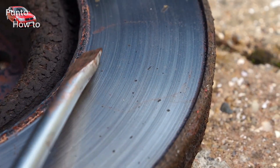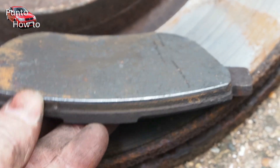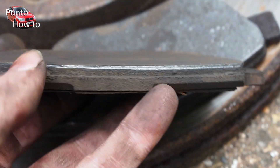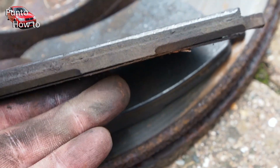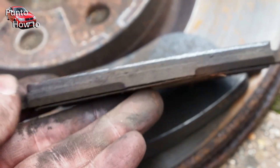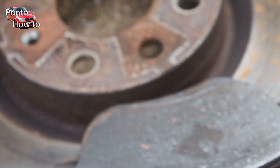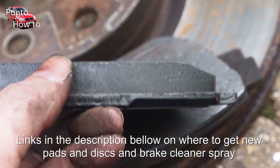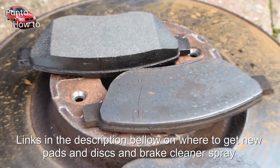They're quite badly corroded and rusted around the edges as well. Turning our attention to the brake pads, you can see there's not a lot of material left on the brake pad itself — maybe a few thousand miles more. Here's the other brake pad from the inside and you can see there's not a lot of material left on that either. Comparing that to one of the new brake pads, you can see there's a lot of material on the brand new pads — a good half inch to three quarters of an inch there. These ones are definitely worn out.